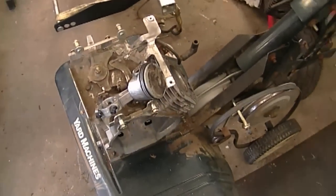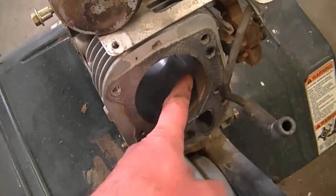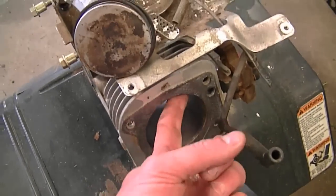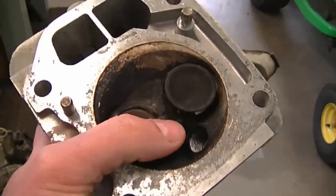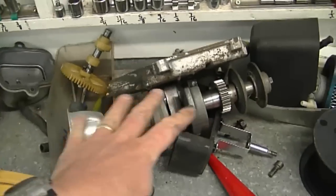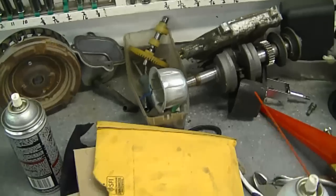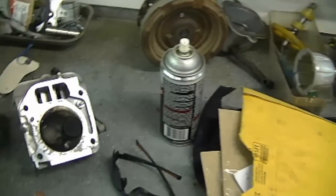The second engine is on the rototiller that you've seen in the Q&A previously. The cylinder on this engine is slightly scored and the intake valve is stuck open. I think what happened is the engine overheated. I've got all the parts of that engine over here — some parts are still good, but the engine is pretty well done at this point.